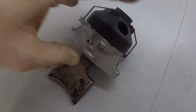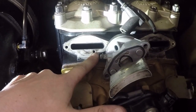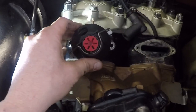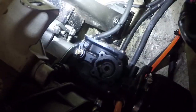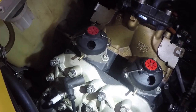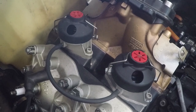Now I've got my valve rebuilt with a new gasket in there, and we're ready to install this back into the Seadoo. To explain this further: exhaust pressure will come up through this hole from the engine, hit here, travel across this channel to the hole we drilled, which will then push the bellow up and push the RAVE valve up. I'll reinstall those now. Normally we'd have a hose connected up here going to the solenoid, which then follows along under the carbs — there's a check valve down there as well. We're going to pull that off since that's our pulse line and just cap it off. Your final step is to connect the two ports that were going to the solenoid together with a length of hose to equalize pressure between the two. Secure those with a zip tie and we're all set.